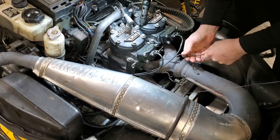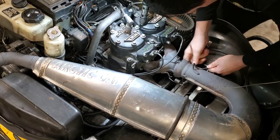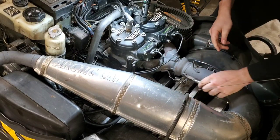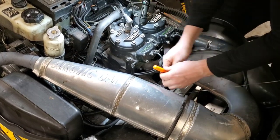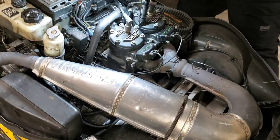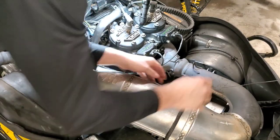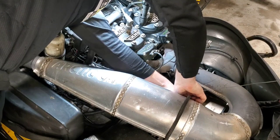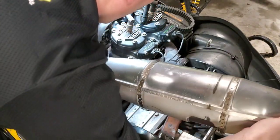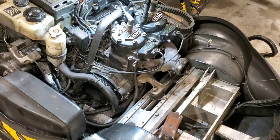I can go ahead and grab a hold right here, pull back — boom, that one's loose. The next ones aren't quite as easy; I'll try the long end. There we go, popped right off. Now for the center spring — you just got to grab a hold of it someplace and give it a good stretch and it comes right off. Now my exhaust will come right off. Be careful you don't lose your sealing surface right in there on either end. Set that aside and now we're down to our recoil.